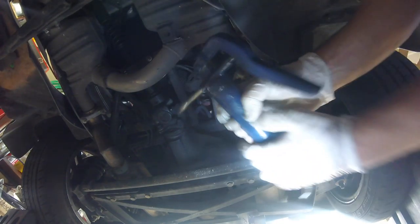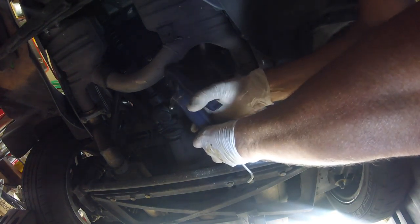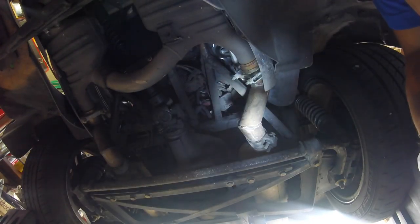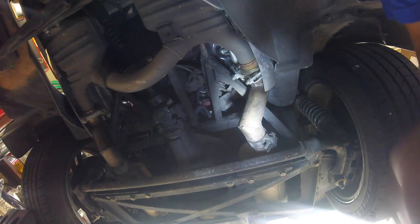There's another u-joint underneath and I'll get that one too - always grease that one, give it a couple shots as well. I probably overdo it but I do it every 4,000 miles when I change the oil. The u-joints are pretty easy to get to once the trike is in the air. That's what I grease every oil change - it makes a big difference. I do all my own maintenance so hopefully I won't have any problems down the road.